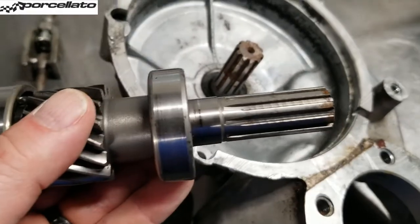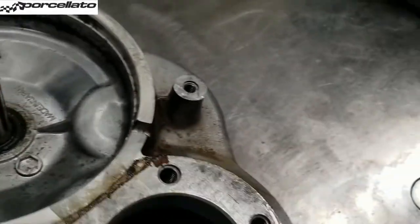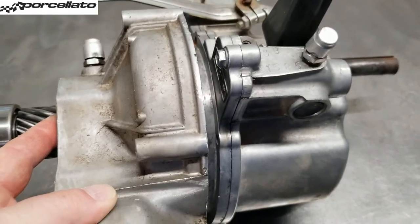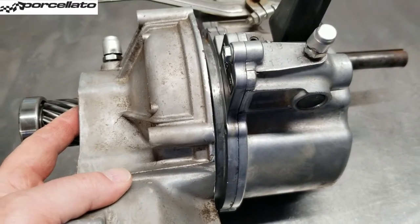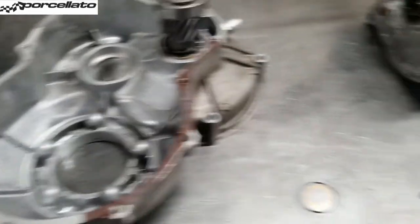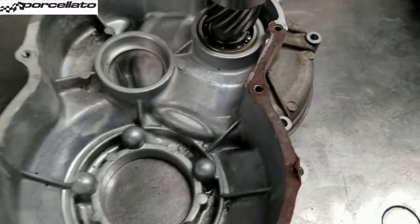Here's a good one — basically we could just wipe that off. Here's kind of a bad one. What you need to do, if you've got an assembly like this mated together and you've got all the hardware out of the way and you can't get this apart, the only way I've found to do this is just split the case. Imagine you've got rid of the axles — I always just pop the axles off — and undo all your case hardware and split the case.